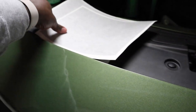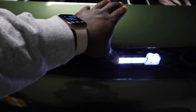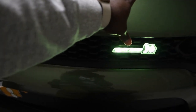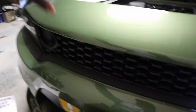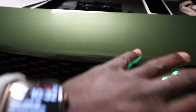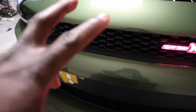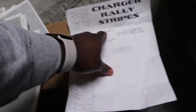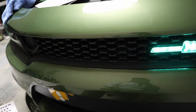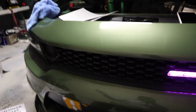My starting point right here — I got two pieces that pretty much match up to this front panel right here. So I'm gonna use that as my starting point. I already matched them up, they look good, I already pre-cleaned it and everything. They do give you the gap listed on the paper, which is two and a quarter inches, so that's something to go off of. They don't tell you where to lay it out — you pretty much just gotta find your center point.